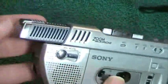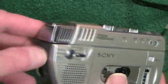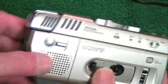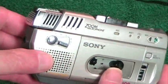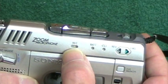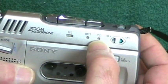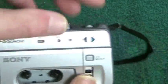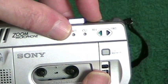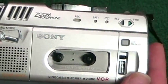In dictation mode you can push the microphone back in or keep it out — it's unidirectional, picking up directly from the front but not from the sides. In meeting mode it picks up omnidirectionally, meaning all of the vents will work. The front also shows a three-digit tape counter, a Q button, and three indicators: one for the microphone showing you are recording, one for battery power, and one for low battery. There is also a directional indicator managed by a switch up here.